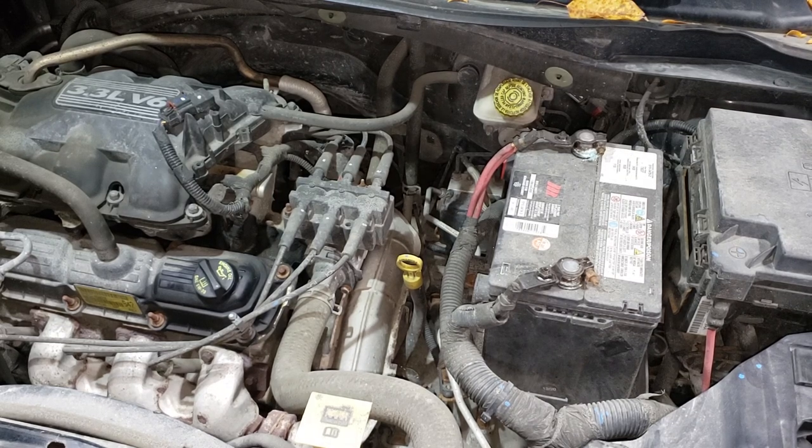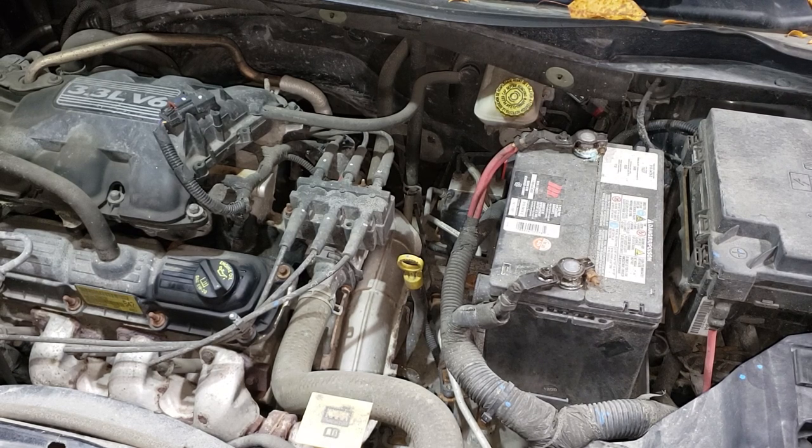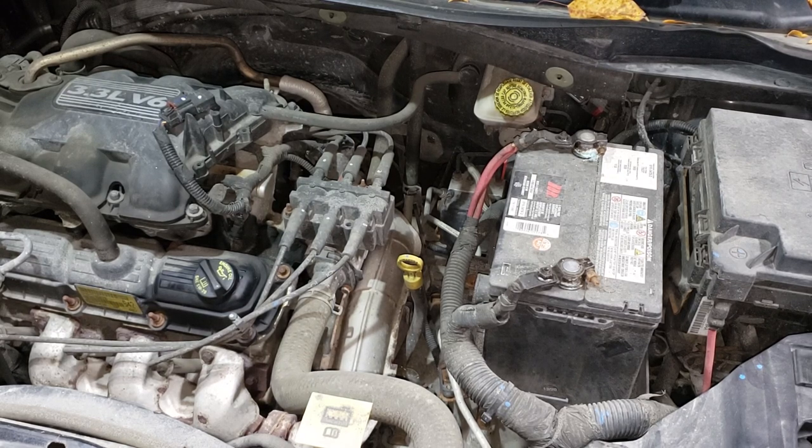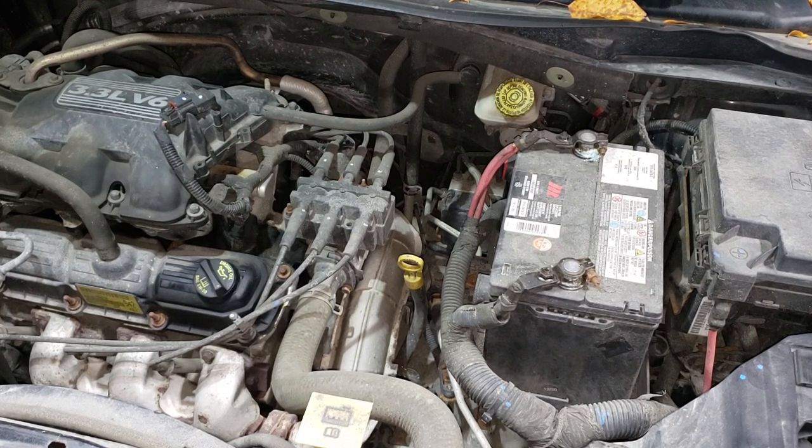In this situation we had a bit of an oil leak, so if you hear a little bit of a sound from the starter, check the engine to make sure the thing actually rotates. I've had stories where a customer said he drove a car home but the lifters were completely trashed. So if you are a technician, do yourself a favor and double check — don't take the customer's word for it, because you don't want to install a starter then find out your engine's seized. Your second step would be to crawl underneath, pull the side cover off, and verify that the engine turns.